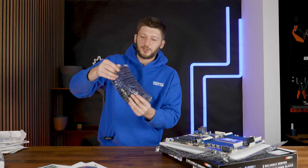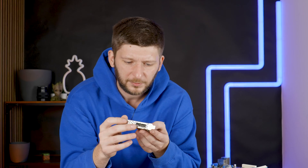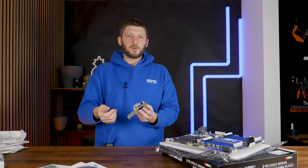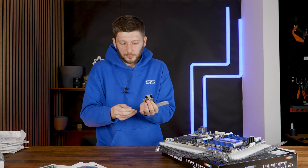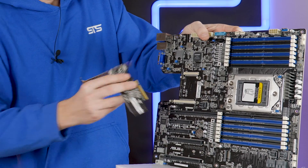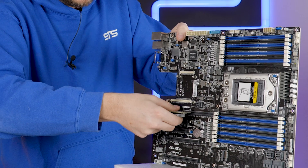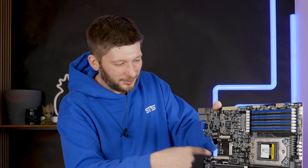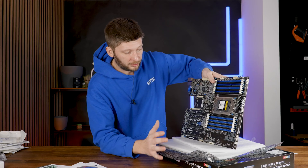What I got for this project is a regular PCIe card with SFP+ fiber connection for networking. It's a 10-gig card with two ports — I'll just use one because my 10-gig switch only has a single port. This is a regular PCIe card that replaces what the mezzanine card was supposed to do. It slots into a regular x8 slot, or I could slide it into the x24 slot. It'll do the networking for us.